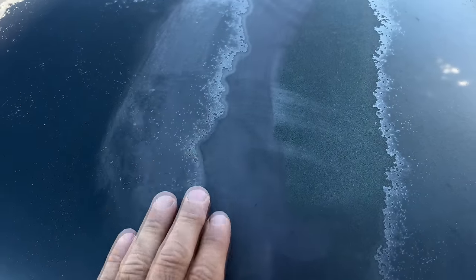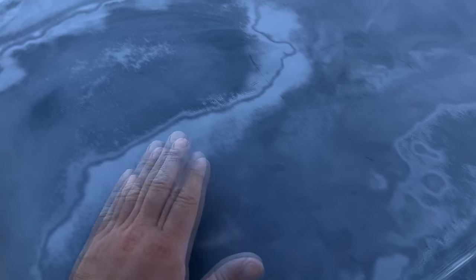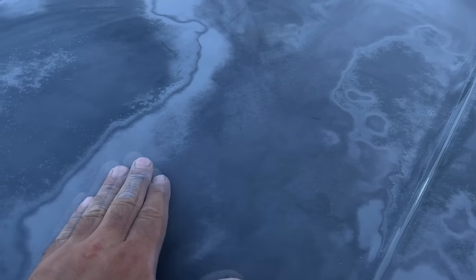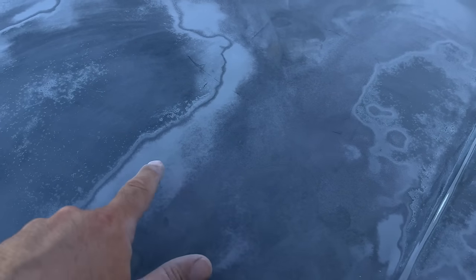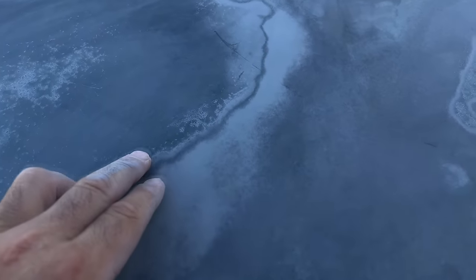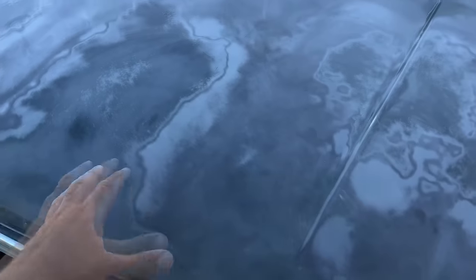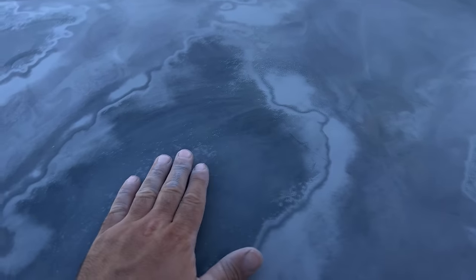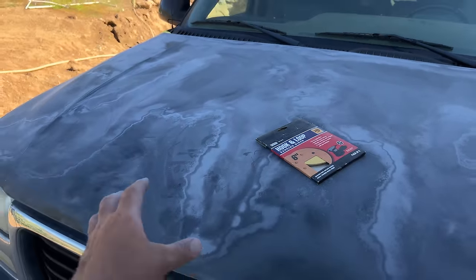Wishful thinking — 600 grit sandpaper will take forever to get these out. We're going to 320. Here's a look at our hood after 320, but we do have a problem. It's going to take too much effort to get the areas that look bad to look good. Ideally you want to get down to your base coat or at minimum the primer sealer that's under the base coat — that's a good foundation. But bare flaking areas are not a good foundation. I'm going to go over those with some 240 grit sanding discs, and I also have 180 grit if that doesn't cut it.